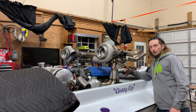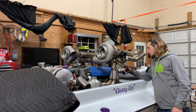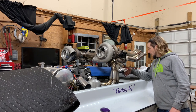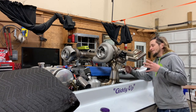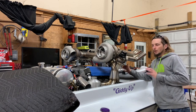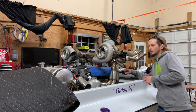So we're modifying the intercooler that was on this boat before. It had some rigid V-bands - it's got dual three inch inlet and a single three and a half inch outlet. I'm getting rid of the regular V-bands and doing Vibrant HD clamps because it's going to be rigid mounted to the framework of the boat. The engine is rigid mounted also, but I don't want to allow any vibration between the two to stress anything, so with those flexible clamps it's going to help out.